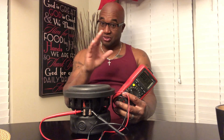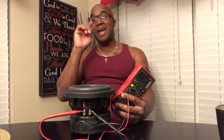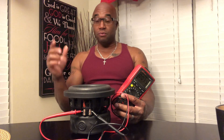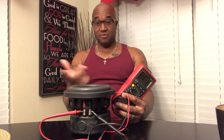Watch this video again so you'll know exactly what you're supposed to read. For example, these are D4 — it reads between 3 and 4. If it reads at 4 or higher, the sub has been clipped, the coil is damaged. If it reads a whole number higher — if it's D4 and it reads 5, 6, 7, 8, 9, 10 — but say it reads 5 ohms, that means it says D4 but the meter tells you it's 5 ohms. It's damaged. Don't buy it. It's finished.